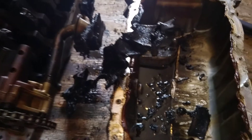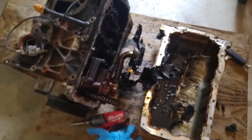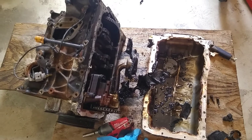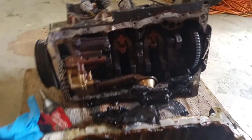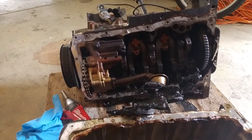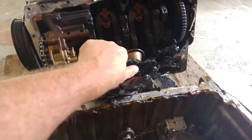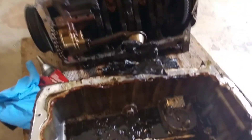Most likely, this engine was overheated, they kept driving it, things started melting and dropping down into the oil pan, clogging up the engine until it burned off all the oil. A word of advice: if you're gonna give your kids a car, you really need to double check everything — coolant, oil, do the oil changes on time — because if your kids aren't maintaining it, this is what's gonna happen. This engine is totally shot, nothing left of it. Hope you found this video interesting, thanks for watching.